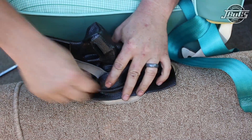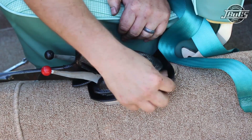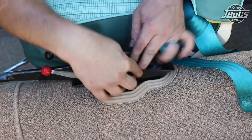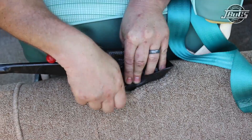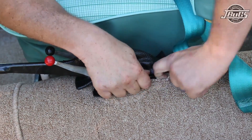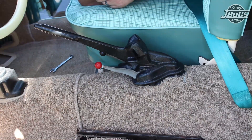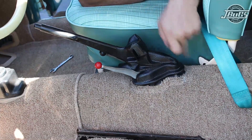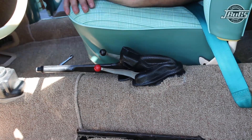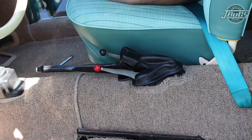You can see that you've got everything installed the way it should be. Now it's just a matter of tucking the flange underneath the cutout in the carpet. With a little tugging and pulling and pushing, we're able to get the e-brake boot in place, tucked underneath the carpet lip all the way around. Parking brake is repaired, cables are now tight, and we've got a new boot in place. We can install the passenger seat, slide it back in, and we are all done.